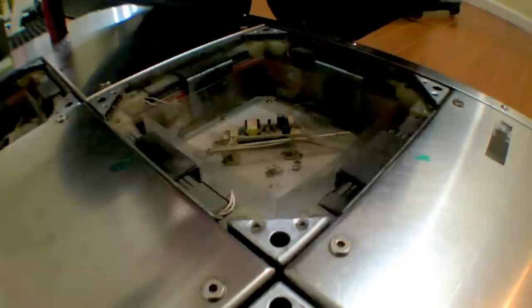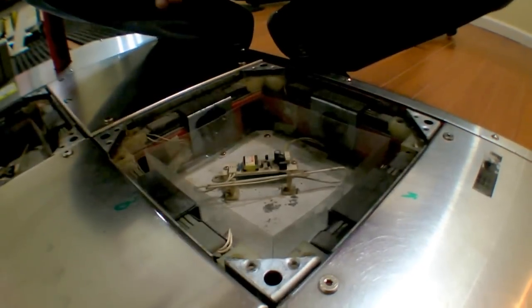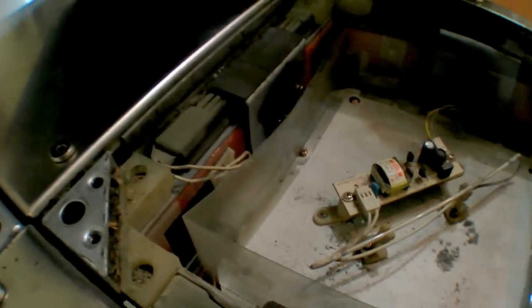If the insulation is stripped, put some electrical tape on it and make sure wires aren't touching metal. Another factor is debris and dirt that often piles up between the sensor and the edge. Ours is honestly not as bad as most, but if you can clean that out — take a very small screwdriver, dig it in there, then use a shop vac to suck it out. You want to do that because debris building up can add pressure and create a hypersensitive sensor.